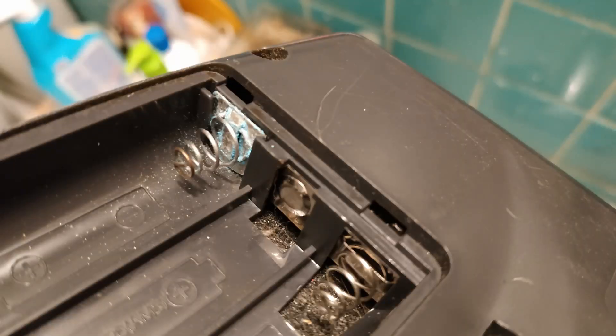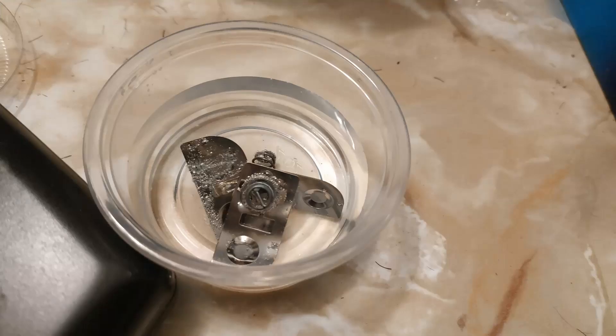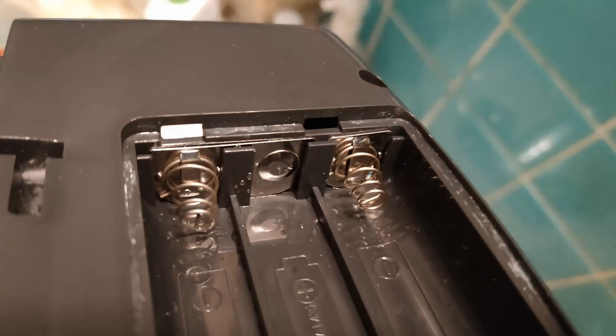While I had all three Game Gears apart, I cleaned the battery terminals — they were all corroded on all three. Most of the contacts pop out of the case. The power goes through all six batteries and comes back through into the power supply board, which has two of the battery contacts on it. The ones I could remove I cleaned in vinegar in a jar, and the ones permanently attached I cleaned with a Q-tip in vinegar. Got them looking like new with just vinegar.